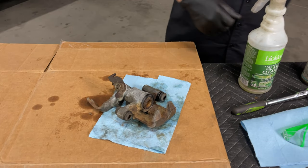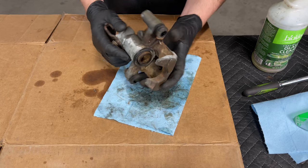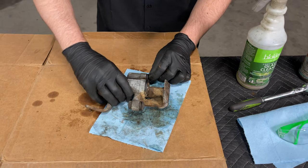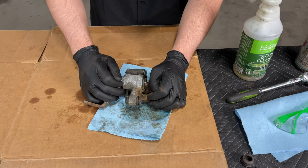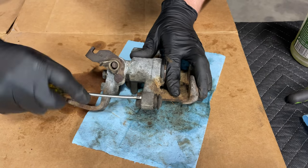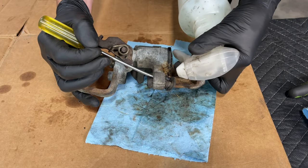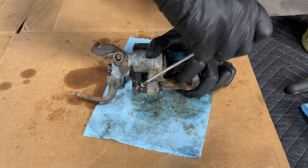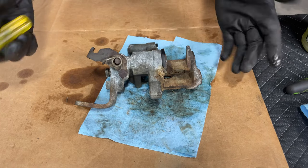Now I have access to the whole caliper with the pads already removed. Since we're rebuilding the calipers anyway, go ahead and replace pads if they aren't pretty new. The next thing is to remove some of the gaskets and boots. One comes off no big deal. The one on the other side actually goes through the caliper housing, so it can be a little hard to remove. I like to shove a screwdriver down in there to push it around, and use a little spritz of Simple Green since it's both a cleaner and a decent lubricant. Just force it out with a screwdriver or pliers — easy.